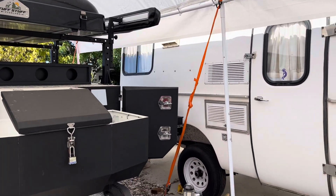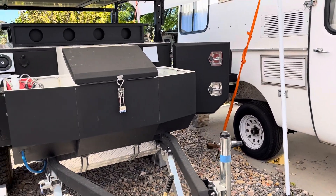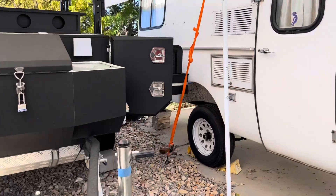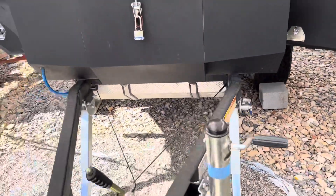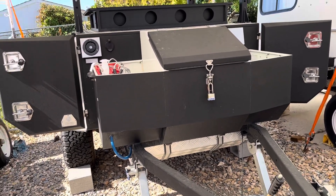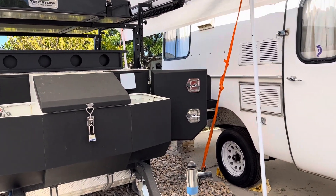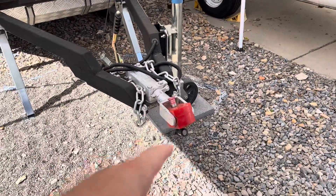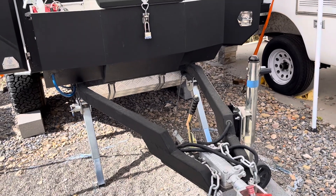There was one spot where I went down and I'm almost positive that with the Casita it would have rolled. Comparing the two — the height is almost the same once you add the tent, but the Base Camp actually weighs more than the Casita. People see it and think they could tow it with a Crosstrek or something, but it's heavy — the GVWR is around 3,300 pounds. We've towed with a Tacoma; it tows better than that. You feel it climbing and it impacts your mileage, but from a ride perspective I'd rather tow the Base Camp. The Casita, even with a sway control bar, has some rocking and porpoising, whereas the Base Camp — just this hitch — no problems at all.